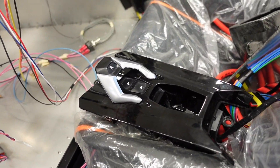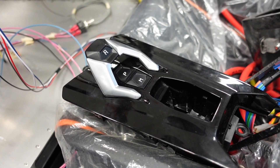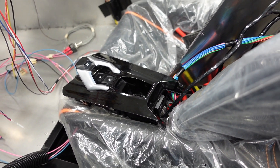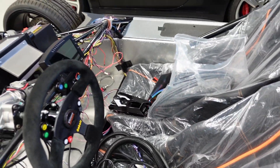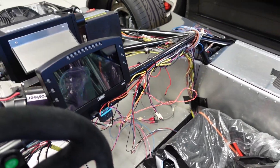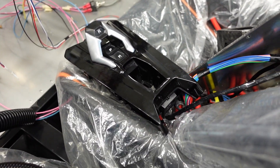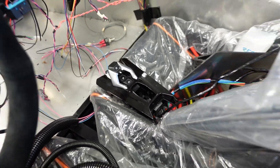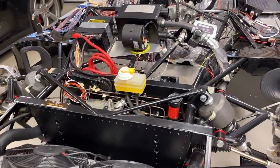The next thing I'm going to do is take the electronic board out of the electronic shifter mechanism, put that board in a little project box, solder some wires to the micro switches inside, and then I can mount those switches somewhere on the dash. That way I won't have to use the bulky housing at all — I can set it up custom. We'll get to that eventually.